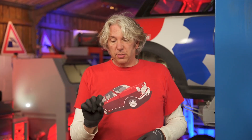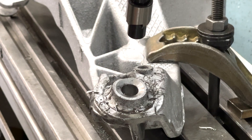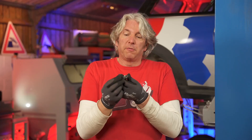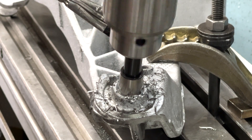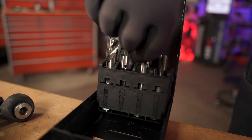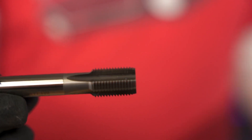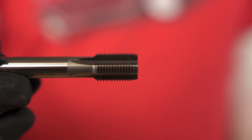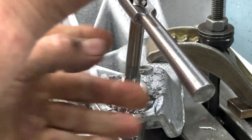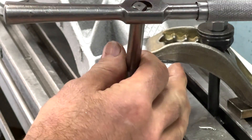The next stage is to use this seating tool to actually counterbore the holes. You've now got your drilled hole, and you can use that little bit of the shank to guide in this counterbore. You can just about see on the edge there, it actually then cuts with little cutting bits. As it's spinning in, it removes the material just to give a little bit of space ready for the top there - that little top hat. Once that counterbore is in place and the seat has been cut, you can move on to the next phase, which is to use a new tap - 16 millimetres by one and a half, whereas the bolt is 14 millimetres by one and a half. You then tap that hole, making some new thread, and this is the thread we're going to be relying on to hold the TimeSert into the aluminium.